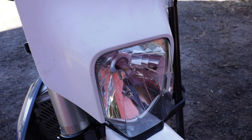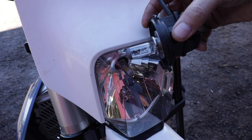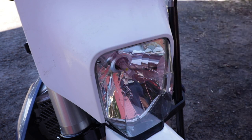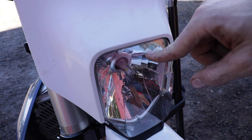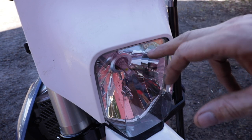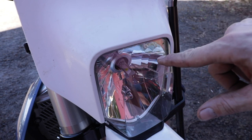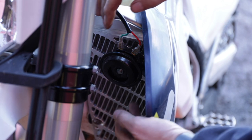The other thing I did was upgrade the front headlight. This was the factory headlight, and I got caught out after dark and had to rely on it — it was pretty much a joke, couldn't see very well. So I upgraded to one made by Cyclops, I think in Idaho. It's an LED and it is wickedly bright — only takes 30 watts. It looks like a Baja racing light. The nice thing is it's got two inputs: a 20-watt and a 30-watt input, so you can have a high and a low beam, and the low beam is DOT approved so you're not going to blind people on the road. For about $100, that is an awesome deal for what you get.